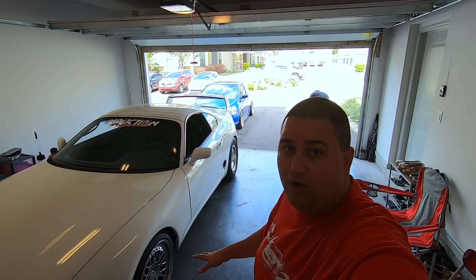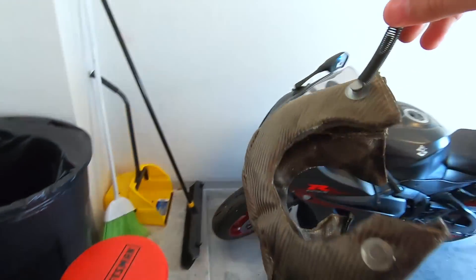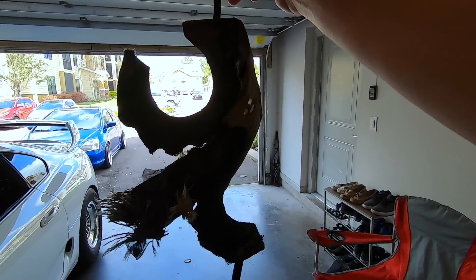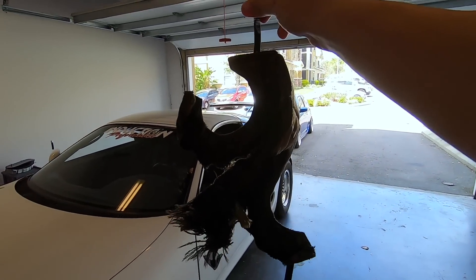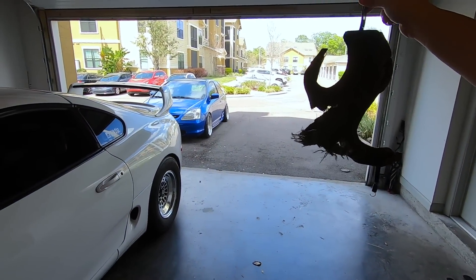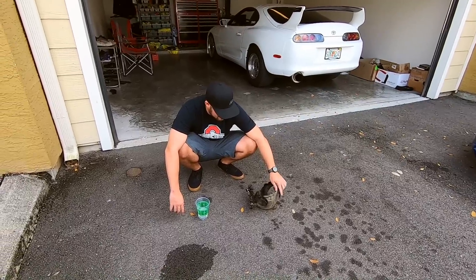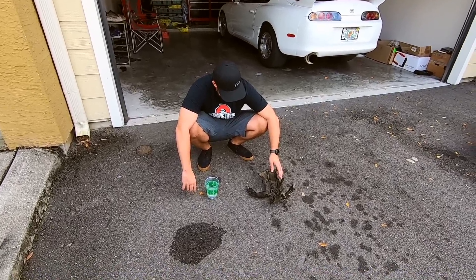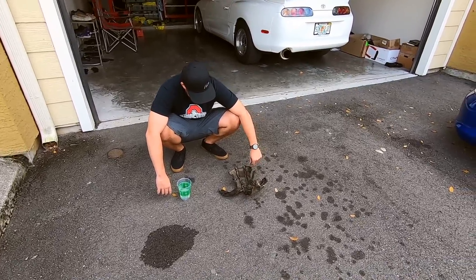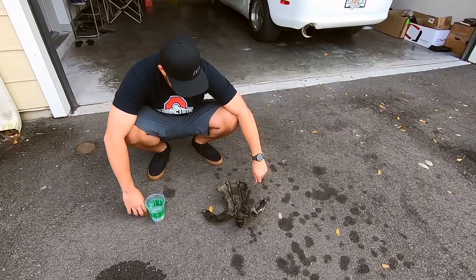So we made that video. We had the turbo blanket on the car and good thing that we did. Let me show you guys this turbo blanket — this thing is absolutely just demolished. That's what was happening inside the engine bay, right pressed up against our turbo. So we definitely have to solve the problem with the dump tube. We're going to go to 360 Customs and just have them make us a custom tube, weld some stuff up. I want to demonstrate — we put E85 inside here, set it on fire, and just see how good the turbo blanket is. So we're going to try to demonstrate exactly what goes on inside of that turbo blanket. I think this is why the Miata got saved because there's a lot of oil and possibly a gas leak. When that wastegate opens, it's blowing a ton of fire out. Good thing we had the blanket on when we did this.